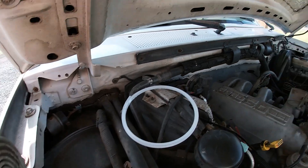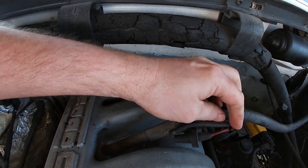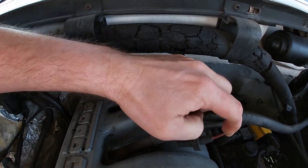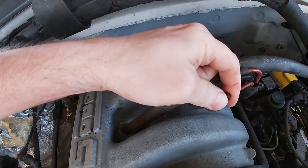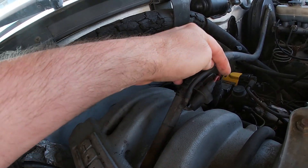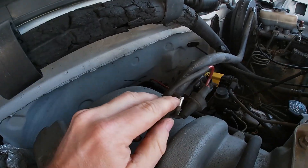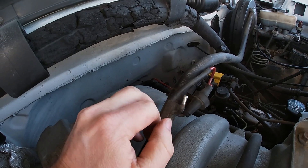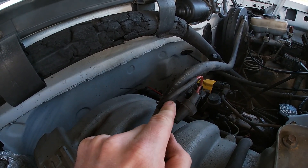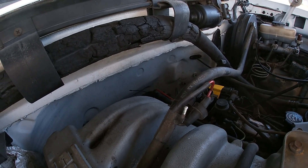The other one — I actually got the red — what's happened here is this red line has broke. And if it doesn't have that little bevel on the end of it, then it doesn't go in this boot. See how it's broke right there? And it's stuck in there, so that's why this isn't attached and it's bypassed — there's nowhere to join those two together. So I need to chase that down. I have this little bevel right there. I've got some red, I'm going to put the little bevel in there and try to get that piece out and plug that back in there and get this plug back in where it belongs. Then chase that all the way down to where it ends and that'll be replaced. That's vacuum lines right there.